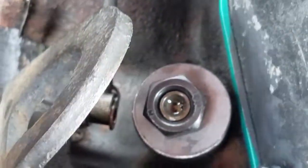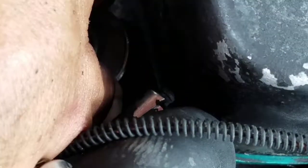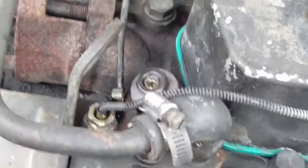Yeah, if I can get it on there. Left-handed. How about that? Alright, there we go. Anyway, you just tighten that up and that pops that injector out. Just make sure you get that little collar that's around it straight. You don't want to go after it all crooked. And just have a good look at it, make sure it's centered pretty good. I've got it centered a little better now. Pops right out, really easy to do.